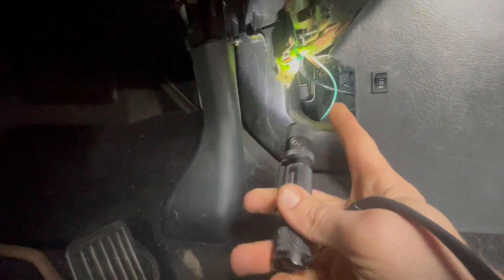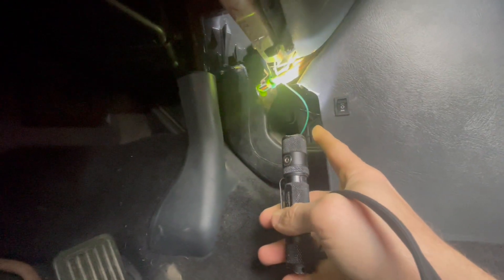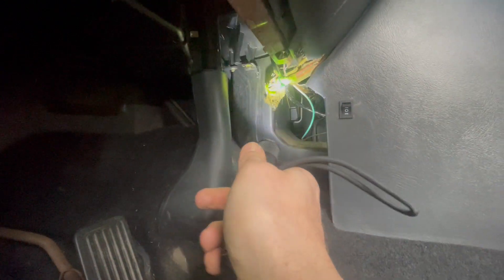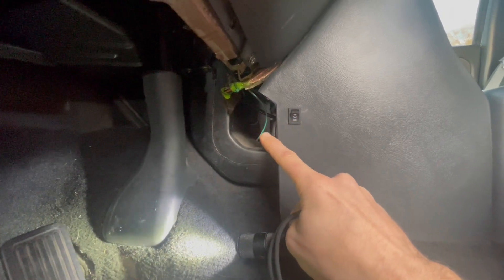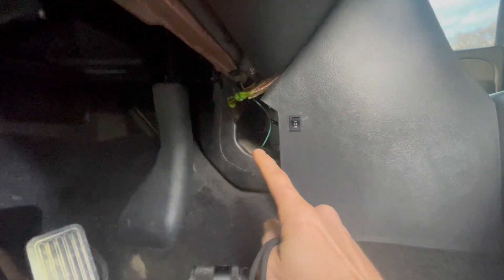Coming in through the firewall, that white little clamp right there is part of the switch wires. You've got red, white, and black — and that comes over with the green. The green comes to my switch here. Since this had an original rocker switch, they ran a ground — that's the black wire on the white clip. The black wire I just cut and left taped over because it's useless since we're not using a two-pin rocker. I have two positions: down, which is for my reverse trigger — the green wire — and on our trucks that reverse trigger comes from the column's reverse from the transmission.